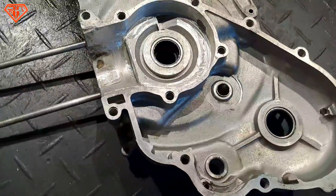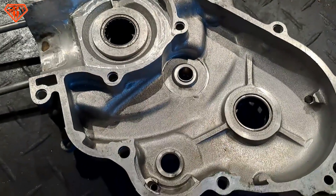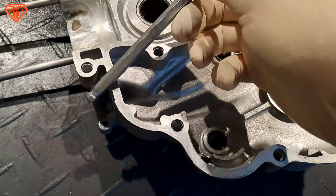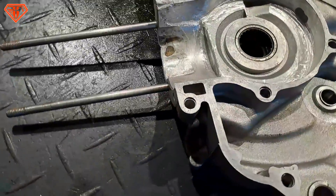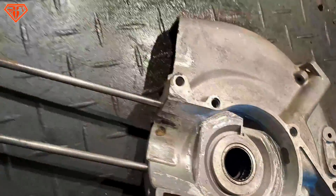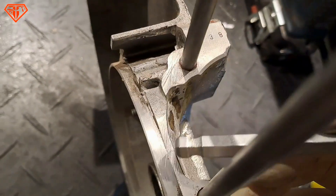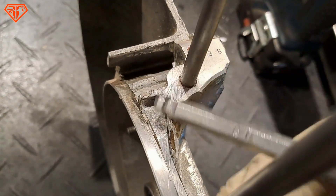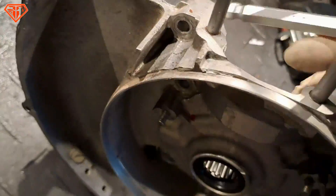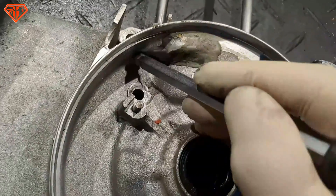An already closed M260 engine, and I want to show you quickly all the fails I found. If you have damages like this — it's not even anymore — you always have to use a rasp and round all the edges. That's normal. Someone used epoxy that broke through at the transfer ports. This is not normal, that's really bad. There was a big pile of epoxy — always do the hammer test and it came off.